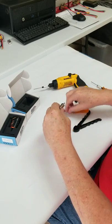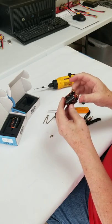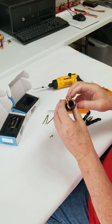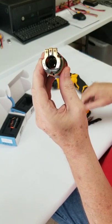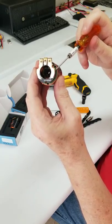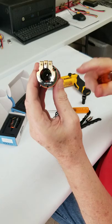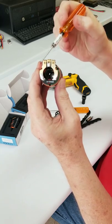That makes the rotating mass inside the rotor. I'm just trying to keep these separate so it doesn't roll off the table. Now this is what is typically called the stator assembly, or the can as some people call it. It's called a stator because stator means it doesn't rotate - this is the non-rotating part. If you look closely down in there you can see the copper wire that comprises and makes the magnetic field for these motors. There are three separate coils called phases, and this is what powers the motor - what your electronic speed control controls to pull the rotor around.